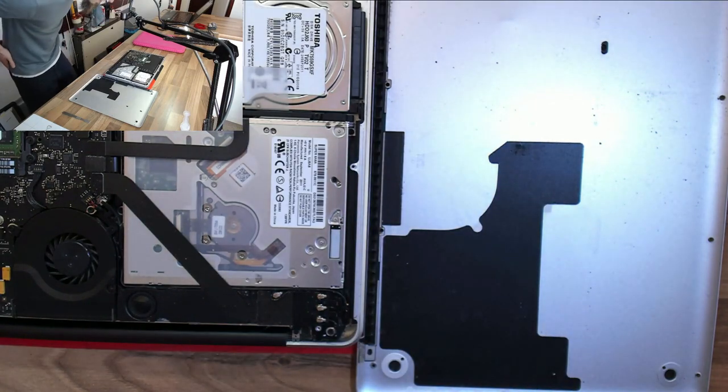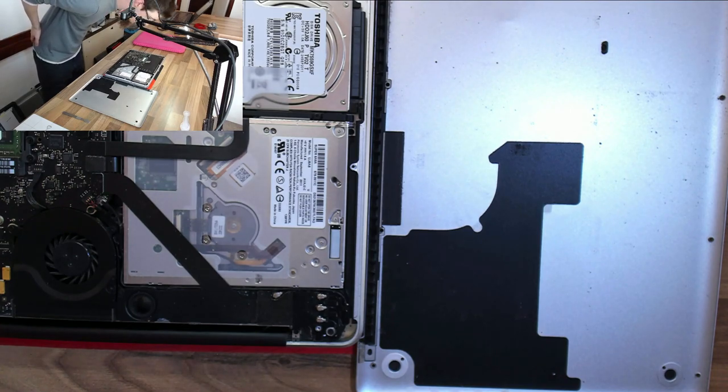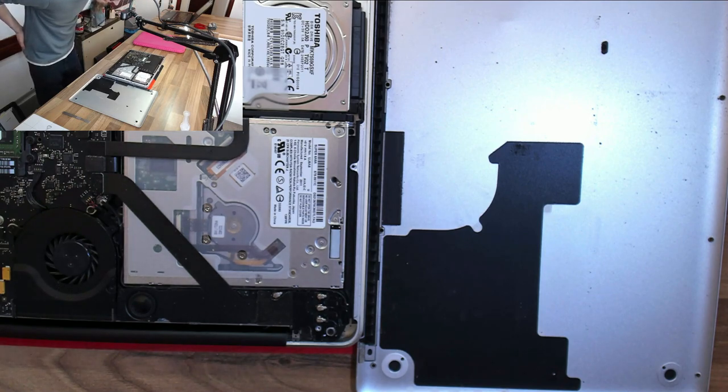Now, because they're mold mites, this would be the logical place for them to be, because the keyboard is where you're going to find a bit of damp and a bit of mold, because that's where you get sweat and crumbs and all sorts of stuff accumulating. There are a couple of bits of dust in the laptop, but nothing really terrible. So what we're going to do now is start taking everything out of the laptop and cleaning it so we can chase everything back into one place.